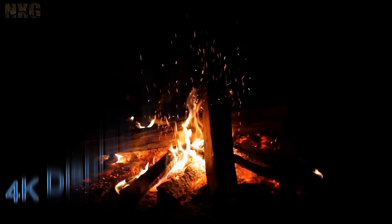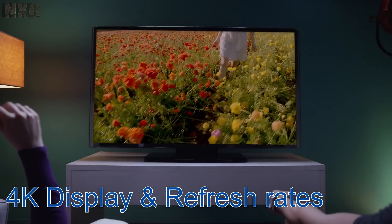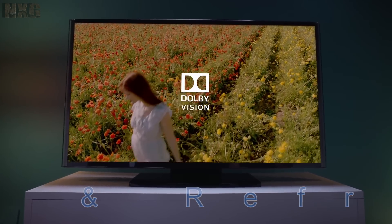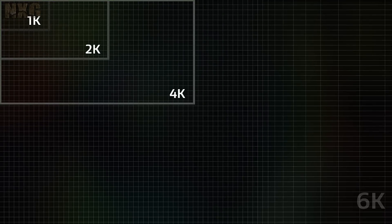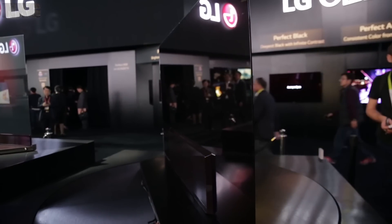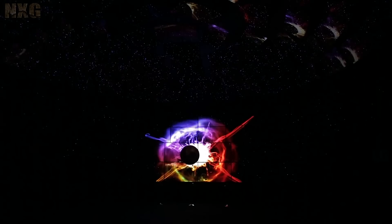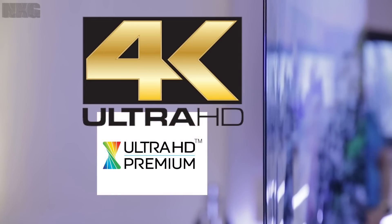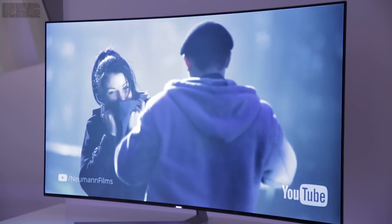Now 4K and refresh rates — this is a very easy one to explain. It simply comes down to the accepted spec of 4K TVs and media, which is 3840 by 2160. Observant ones amongst you will notice that is twice the size of a standard 1080 display and gives you 4 times the amount of pixels. To be considered a UHD display it will need to offer this or the other 4096 by 2160, but if it says 4K, UHD or the new Ultra HD Premium, then it will have you covered in the resolution stakes.